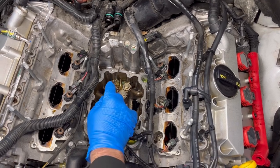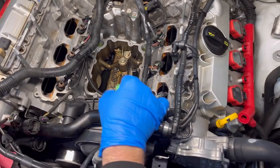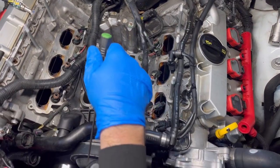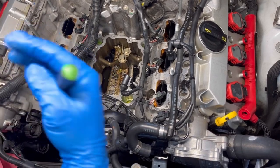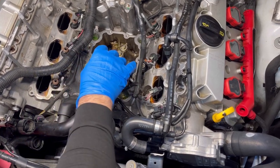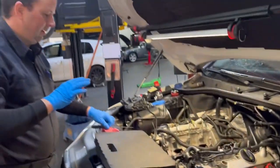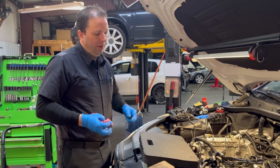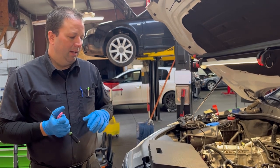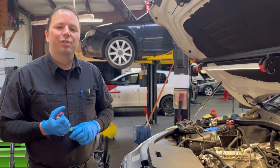The vent trim typically leaks right across the back — coolant passage one and coolant passage two — filling up this valley. These voids fill with coolant, which runs to the front because that's the lowest point. The coolant runs out the front of the engine, gets caught up in the belts while the engine is running, and that belt slings coolant all over the engine bay making a real mess. That's the culprit. We hope this helps — post any questions below. Thank you for watching another PAD video.